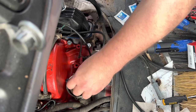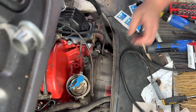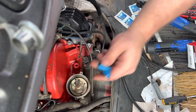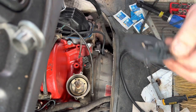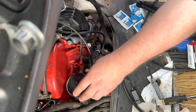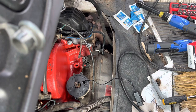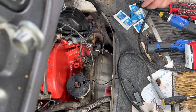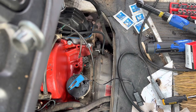It's a slot - it will only go on one way. See, if I turn it 180 out it's not gonna go. That's a nice thing about these Magnum engines, it'll only go one way. See how that slides on and off - that's better. Now let's set our pickup on there. The distributor pickup sits in this notch; the cord comes out and lines up with this notch. These two holes will line up with the screw holes for the cap. It'll only go on one way.